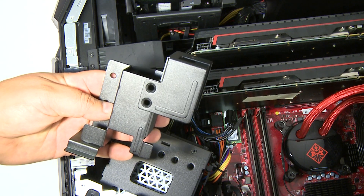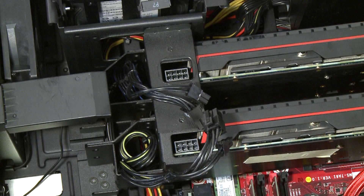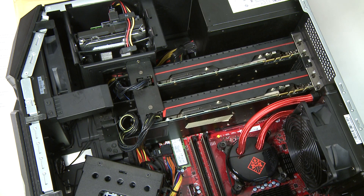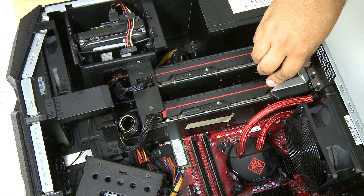Reposition the bracket on the back of each card and secure the three screws. If originally installed, reattach the bracket bridging the cards with three screws. Reconnect the power cable for each card. For configurations using a bridge, position the tabs of the cards under the slots on the bridge and then slide into position.